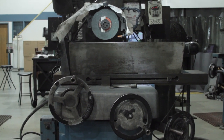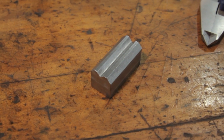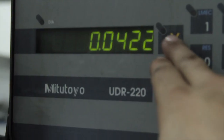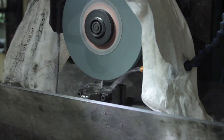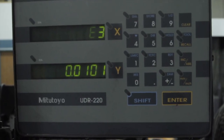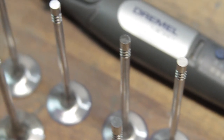To grind the valve tips, I'm using a surface grinder, a V-block, and another small V-block I made on the mill just to clamp onto the valve stem without damaging it. We're going to work our way down gently until it just skims the tip of the valve stem, then zero the readout. On the exhaust valves we had 13 thousandths lash and need 18 to be at the bottom of the range, which means we need 5 thousandths more. The rocker ratio is 2-to-1, so whatever I do to the tip of the valve shows approximately half that at the roller. So I took 10 thousandths off the exhaust valves and 35 thousandths from the intake valves.